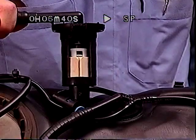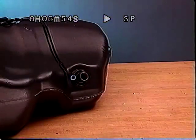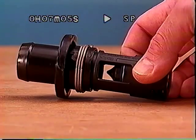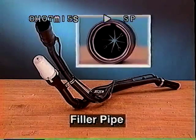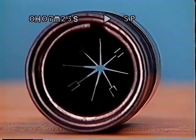The float valve also closes in the event of a rollover. Positioned behind the fuel tank, the canister typically stores 80 to 90 grams of hydrocarbons during a refueling and has a maximum capacity of 150 grams. The fuel tank non-return valve is positioned where the filler tube mates to the fuel tank; it ensures that fuel vapor cannot travel up the filler tube and limits fuel spitback during a fill-up, making gasoline siphoning impossible. The fuel filler pipe incorporates an insert to center the fuel pump nozzle and draw in ambient air during fueling. The 25-millimeter diameter pipe increases fuel velocity when filling, helping ensure all fuel vapors are drawn into the tank.